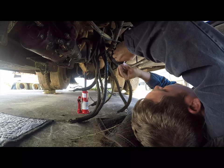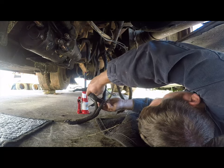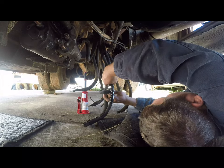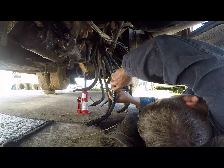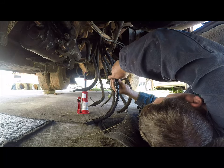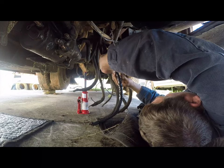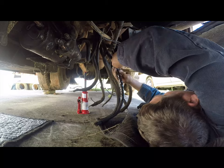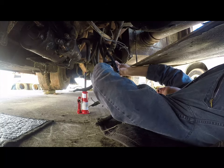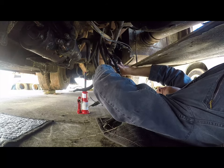I know I'm kind of bouncing around on this, but this is just how it goes sometimes. I'm going to finish repairing this damaged insulation. It's 2228 3M moisture sealing heavy duty rubber tape followed by a layer of just regular old 3M cheap electrical tape. It's good stuff. Not necessary to retape it a second time, but it didn't hurt nothing, and it reduces the opportunity for these direct to battery cables to rub and touch something, and that, my friends, is really truly what matters.